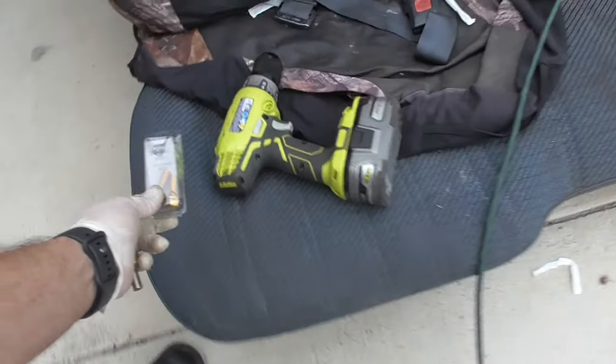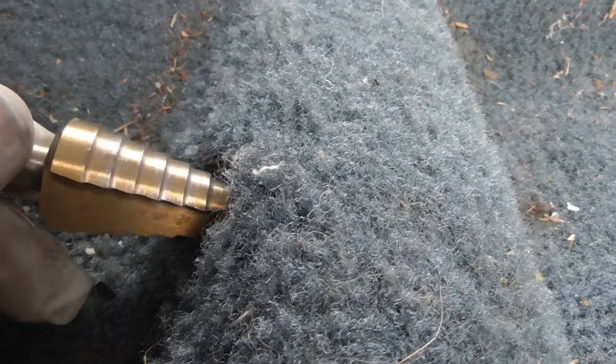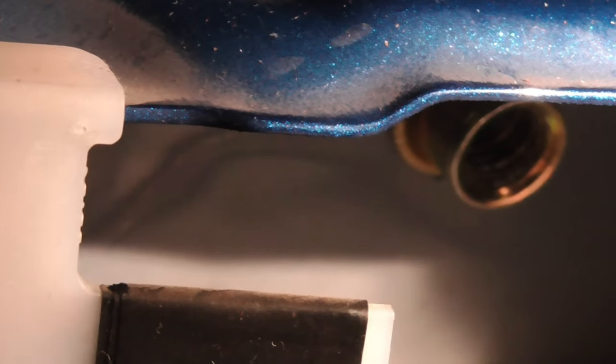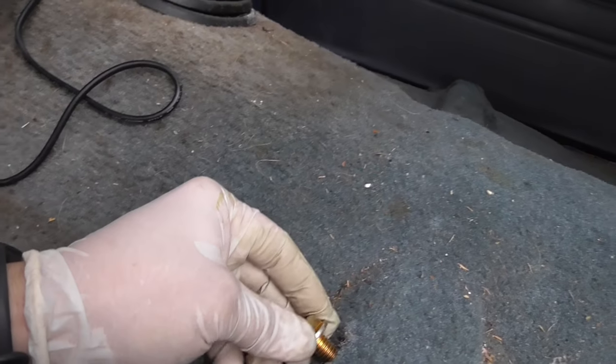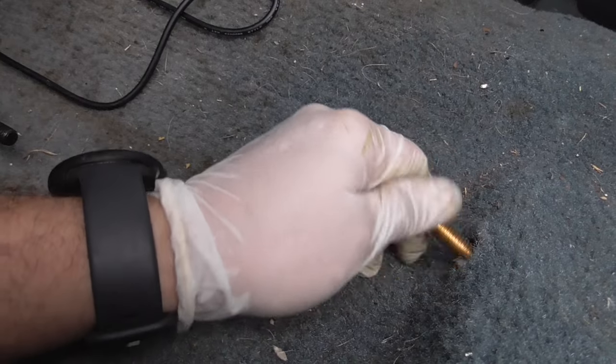The hole's big enough. I'm going to get to drilling — looks like I've got to go about 3 or 4 steps in. There's the rib nut, and the back side — you can see how it mushrooms in the back. The 9/16 was a little bigger than I would have liked. I'm probably going to take the other one and use the half inch and just kind of wallow the hole out, because I did not like how the lip on the rib nut didn't sit like I wanted to.